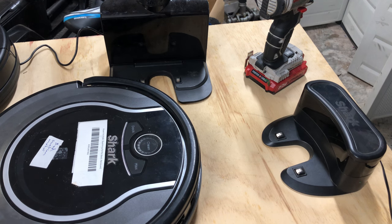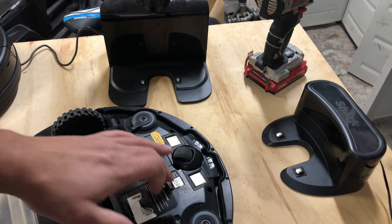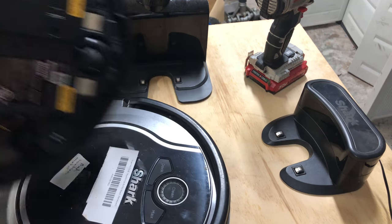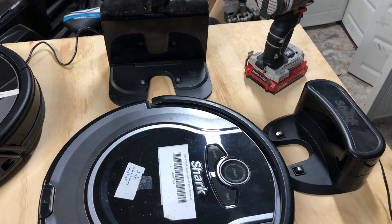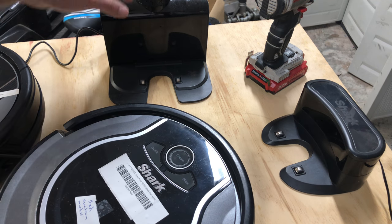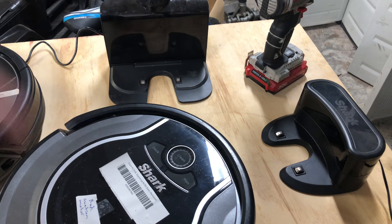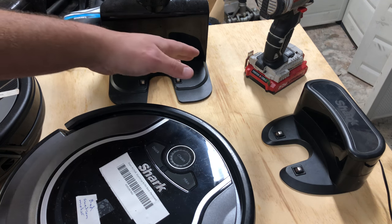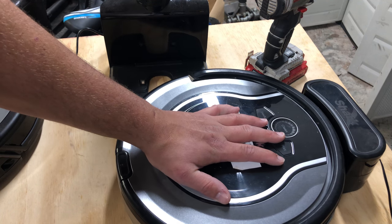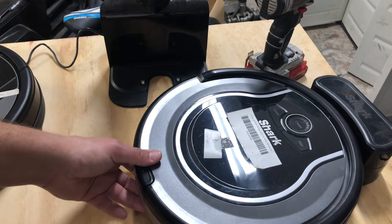A battery error is going to be a certain amount of flashing lights depending on which model you have. This is a 750 and this is an 850. If you've tried all that, make sure if you're going to clean anything — have the robot off, have the charger off. Use 91% isopropyl alcohol; it'll clean it and dry it and won't harm it. Check for tears in your wires. If those green lights aren't on, it's not going to work. The main issue I'm seeing with people and chargers is it's just not lined up — it died and they put it on there thinking it's going to charge, but you still have to get it lined up.